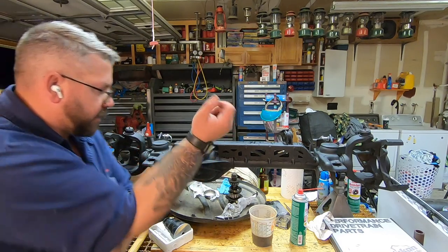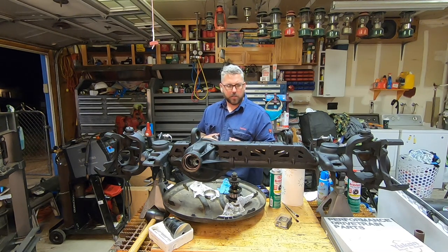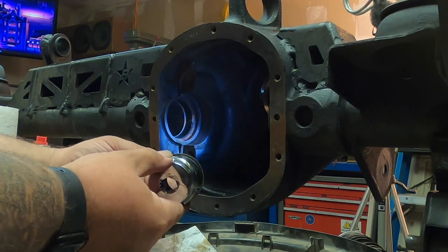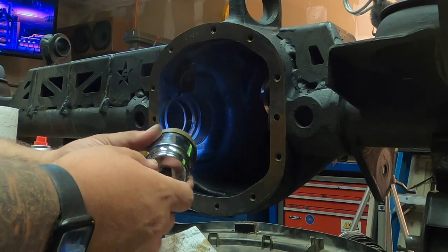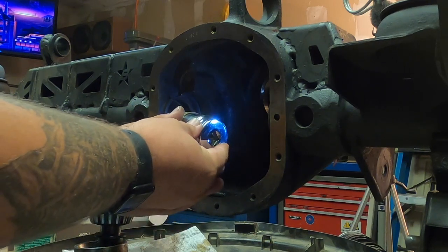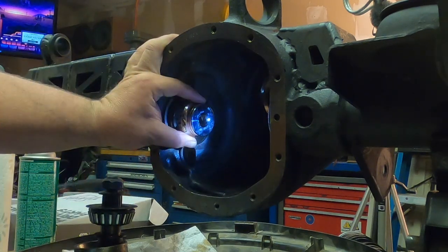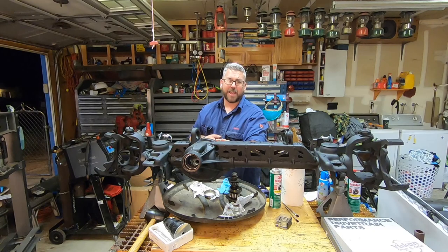The seals might get a little bit tricky. The seal is shaped a little funny, and it's kind of a pain because there's no way to hit in here directly. So what I'm going to do is — I've got a nice-sized socket which fits just inside the groove. I'll go ahead and take just a little bit of oil around that outer edge to help it slide, set this in place, run a pipe through my axle tube, and drive it in. Hopefully it works out just fine — we'll find out in just a second.